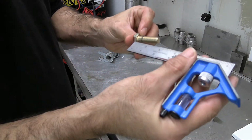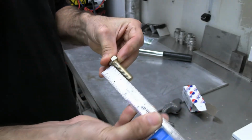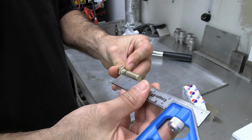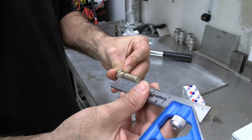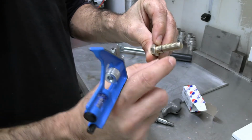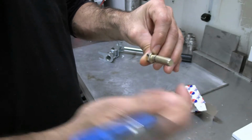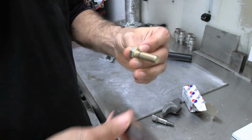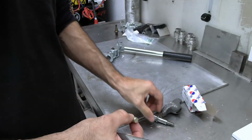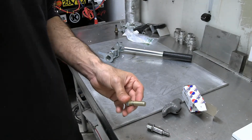On the bolt, it's a graded bolt. It's 1.5 inches long. Make sure you use a graded bolt. That is approximately a little over a 1/4 inch where I marked it, because I'm going to use 1 inch for threads from this bolt. So 1 inch of threads are going to be used to weld onto this. Alright, let me cut these up.